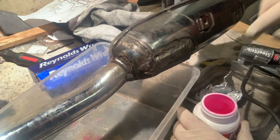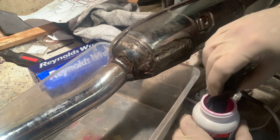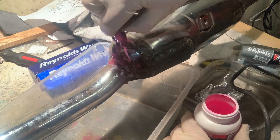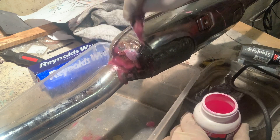We got that cleaned up pretty good. The deeper you go, the more gets revealed, so it definitely does look like this is a bit of a problem spot. Again, I don't see it going all the way through. So let's give this another treatment of naval jelly — be super liberal when you're putting this on, make sure you're pushing it down into any crevasses. A lot of comments have come in saying why don't you just use naval jelly, so we're giving it a whirl today.